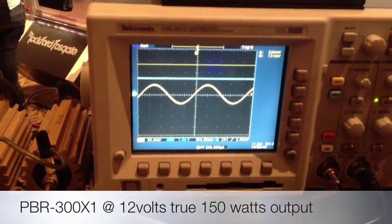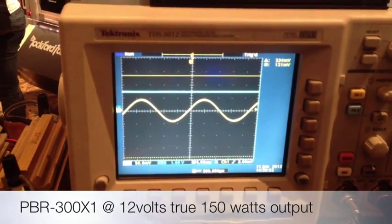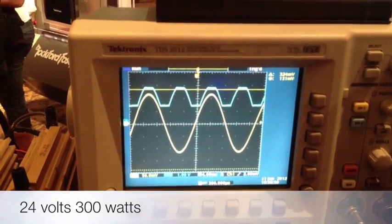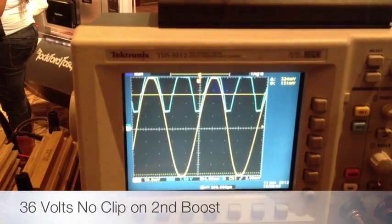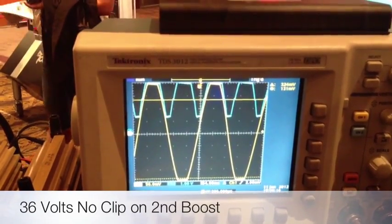So you're looking at your sine wave and you're looking at your voltage that's available. Right now it's the battery, so let's say it's 12 volts. And then with the 301, you get up to about that level there — that'd be your two times battery, so 24 volts, 300 watts. Now we're getting a second boost on top of that, which gives us that 36 volts. Almost nearly un-clipped, too.